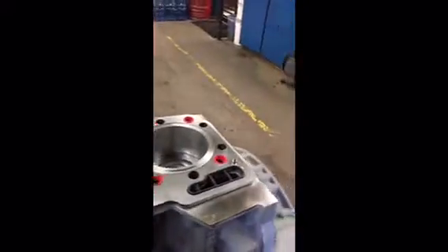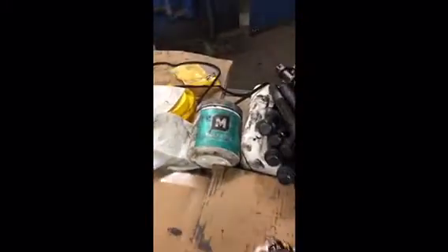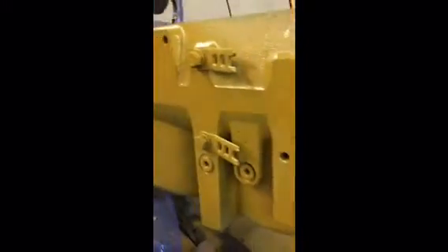That's just showing everything prepped — that's what I rubbed that on with, and that's how I did it. The bottom of my head is clean. We steam them off, and there's always water and stuff dripping off there, and you hate that when you're about to go on with your gasket. Because once the head's torqued down on there you don't want to be finding something on your bench.